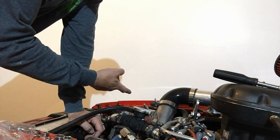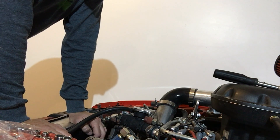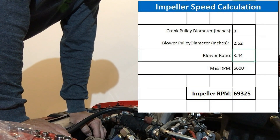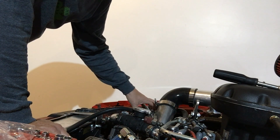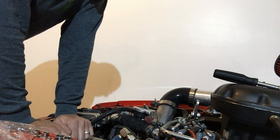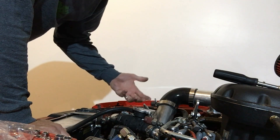For reference, I've got a blower that I upgraded to bearings rated up to 65,000 RPM. And at 6,000 engine RPM, I calculated I'm spinning it at about 69,000 RPM. So because the supercharger gets so hot — because the bearings are spinning faster than they're designed for — the belt starts slipping because it can't get traction. The internals get hot, metal builds up friction, the compressor loses efficiency, and you basically lose the boost you were getting.